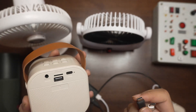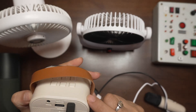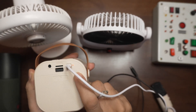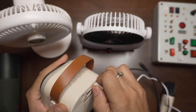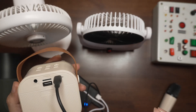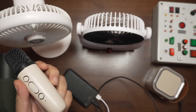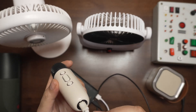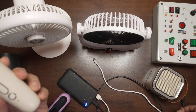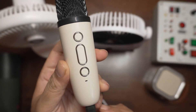Let's try this karaoke device — it's a relatively cheaper one. So I'm going to use the Type-C first. There's a red light indicator there, but it doesn't come on. But if I put a Type-A cable, you can see that the LED is actually glowing. So Type-C — no light, it doesn't work. Same with the mic — this is the karaoke set's mic. If I use the Type-A to Type-C cable, I can see there's a charging light. But if I use the Type-C cable or the Type-C output to charge this, there's no light — nothing happens.